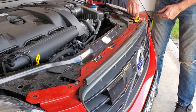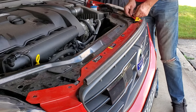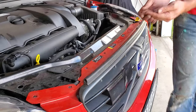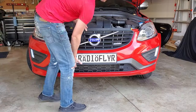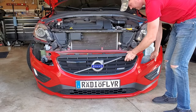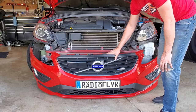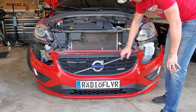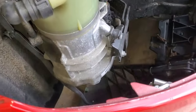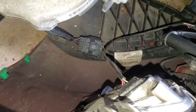This one's a little tricky around the hood release but it's definitely manageable. Set it down carefully and then we'll go ahead and take a look at what electrical connectors we need to undo. Looking close up on the passenger side, there is the main electrical pigtail that powers the fascia, the fog lights, and everything else right down in there.